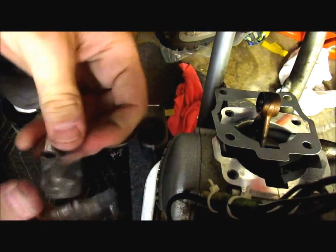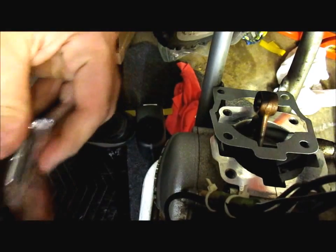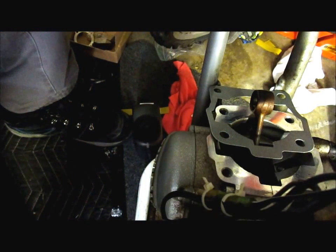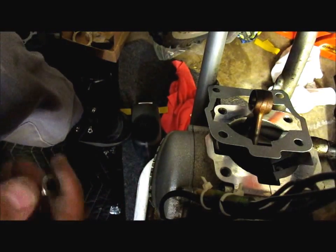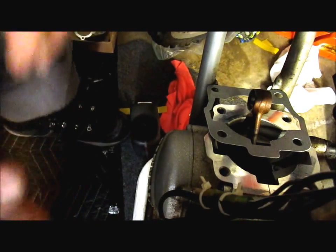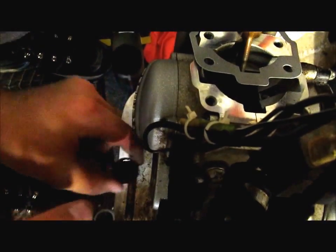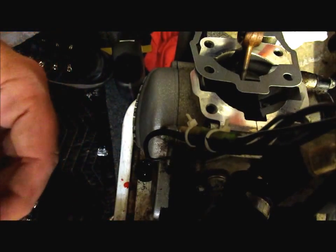All right, so now we're going to take the wrist pin out. Let's just get the right tool for the right job. Okay. And it's got some lubrication in that baggie, which is good. Ow. Almost cut myself. Yeah, oh well. Get your bearing. What you can do, see the cup down here? Well, no, you can't. I got the cap down here. Just set that in there, get that thing lubricated up, and get things rolling here. Now, most of this stuff's just going to burn off anyways, but hey.